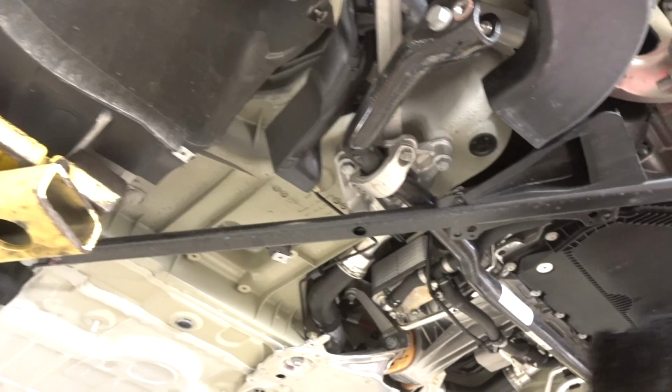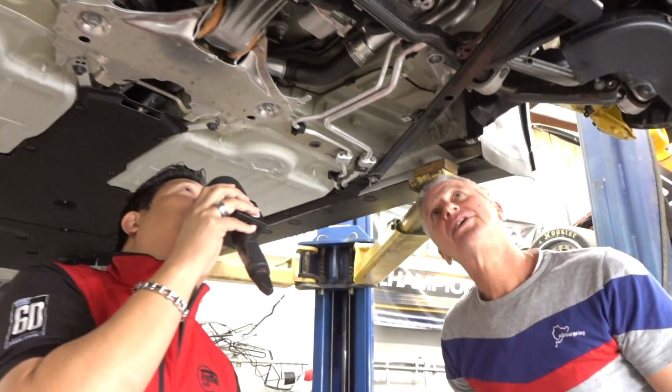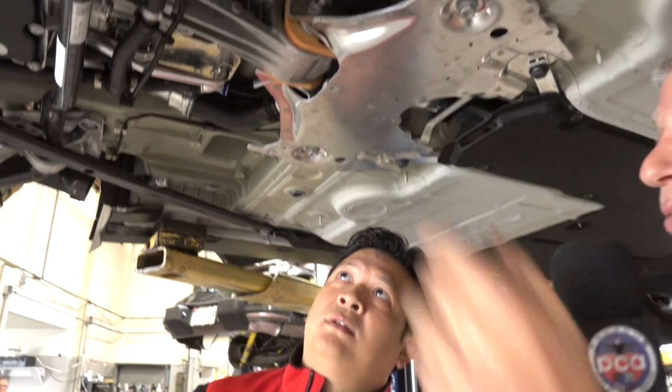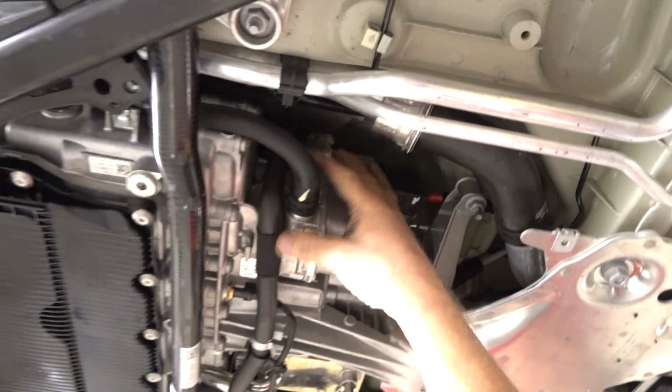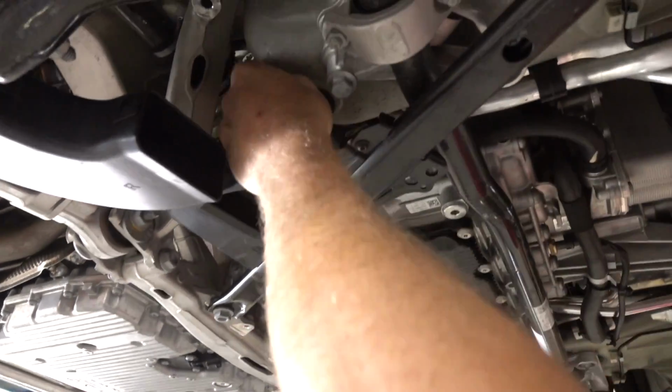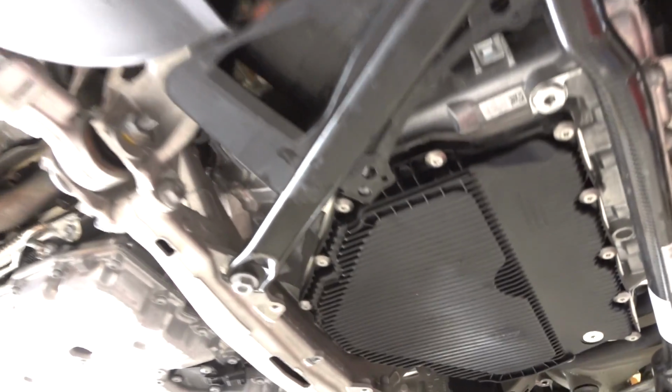And while we're standing here, I see some more coolers. Can you explain to me what these are? Well, this side is different. Actually, I just finished servicing this. This is the gear oil section for the differential. This side of the PDK transmission is the differential, and the ring and pinion are in this section back here where the drive axle comes out. That's the output flange. And this holds about 4 quarts of 75/90. It's quite a bit of oil. It was very dirty after 1,500 miles of Nordschleife. Again, I think that's to build it up so that when you're running it hard, you have more than enough. It's unbelievably over-engineered. It was engineered as a motorsport car.